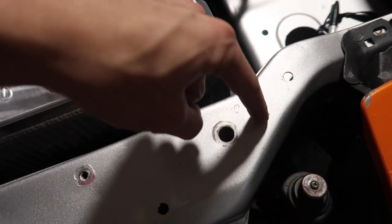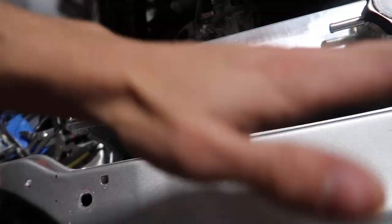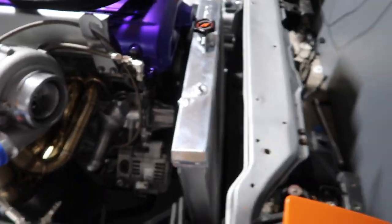The plan is to open up a lot more room - I'm going to chop right into this thingy and we're gonna lean the radiator pretty far in. I think I'm gonna cut to about here, so that's pretty deep, and we can get a pretty gnarly lean on there. Then we'll throw some fat fans on there - I'm thinking some Ford Taurus ones or just some really high CFM fans.